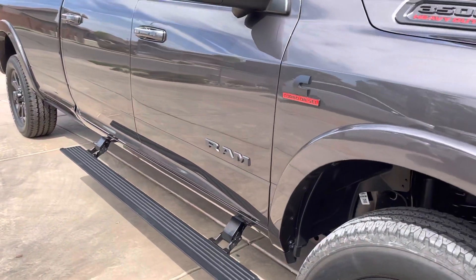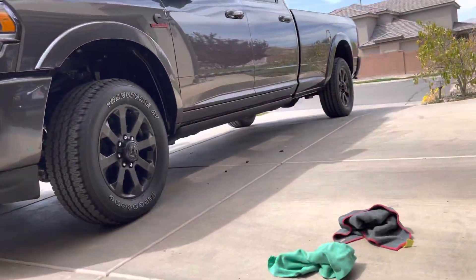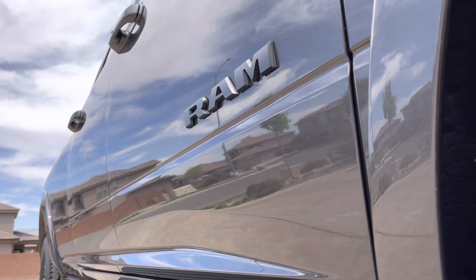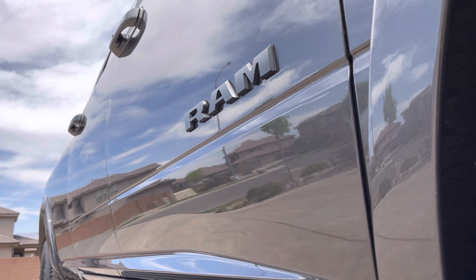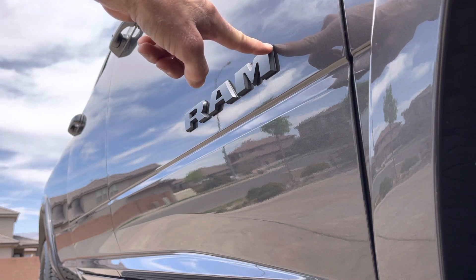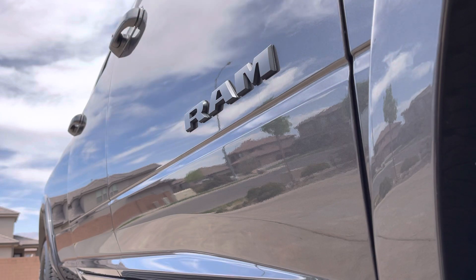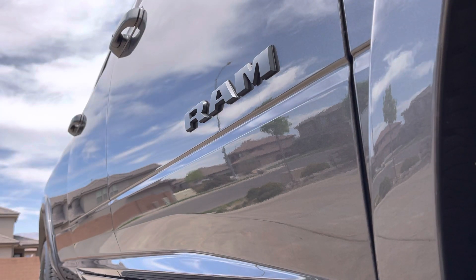So I'm just using some fishing line — the strongest I have is 10-pound test. My temperature out here right now is probably 70 degrees; I just pulled the truck out of the garage, it's probably 60 degrees in there, so it's not super hot. I haven't pre-warmed any of these stickers. I've done it both ways — used the fishing line to pull the decals off and left the sticker on and just used the wheel, and also pulled off as much of the sticker as I could with my fingernail and thumb and ended up getting a blister — and it didn't make a difference. So you're basically wasting your time trying to get the big foamy portion of the adhesive off. Just leave it on and use the destriping wheel to get that off.